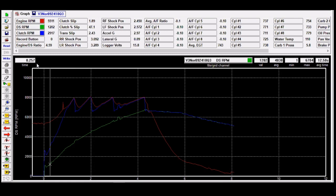These cars, just from experience, 1,800 RPM is about what you want to see for drive shaft RPM at that point. So it's 600 soft, which, going back to it, we know we could have hit it harder. We know we're soft. We already knew that. We need to apply more pressure. So let's move on out here to a half of a second.